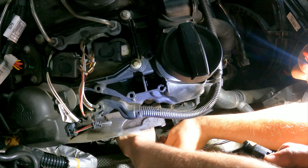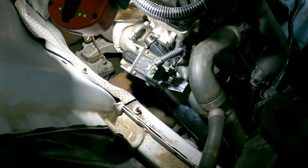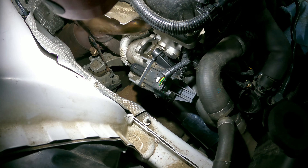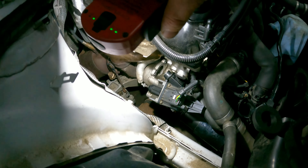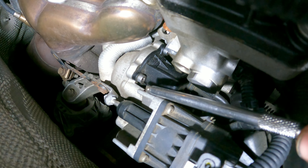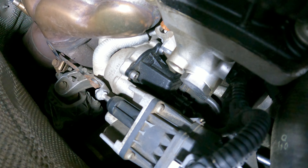You're going to want to remove your wastegate before you remove the bypass valve. We marked where the jam nut originally was for the wastegate so we can put it back in the same spot. Liam's gonna hold one side, I'm gonna break this side loose. You have to remove the pipe coming right off the turbocharger outlet to get to the bolts for the wastegate. The wastegate bolts are a T-45.